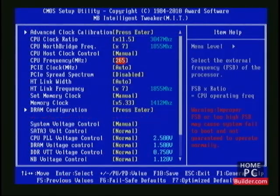As long as the speed is 260 MHz or more, that should be all the reference clock speed you will need to overclock the other components. After performing these tests on our motherboard, the maximum stable reference clock speed is 270 MHz.